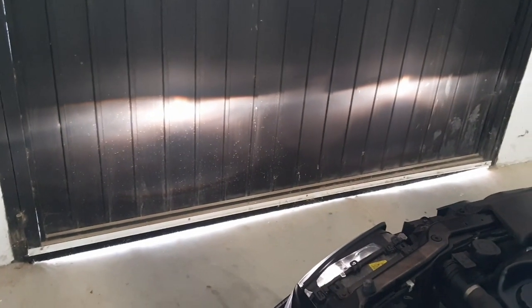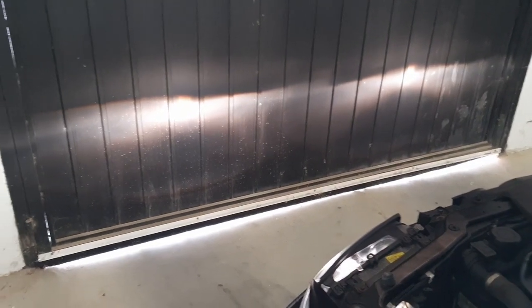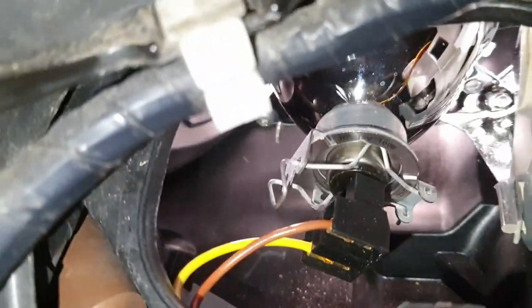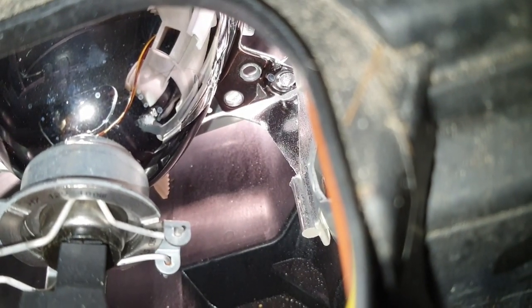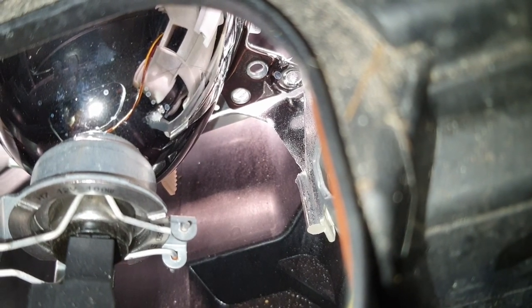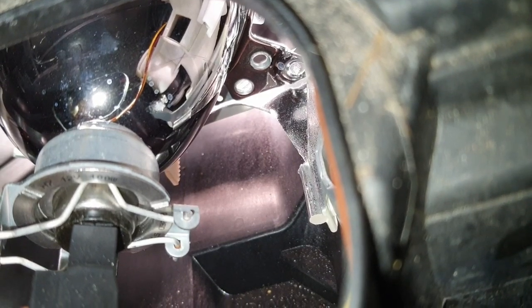I've just flicked the switch on the headlight beam of the BMW E46 and it's up to the left a little bit, like a little eyebrow. I'm using that screwdriver because it's long enough and strong enough to get to this plastic little clip. On the previous still image you can see it's that tiny little grey-green piece of plastic sticking out the bottom right-hand corner at about five o'clock. So yeah, that's how you do it — that's the switch.